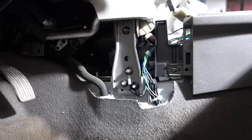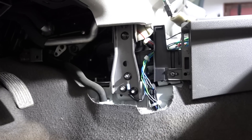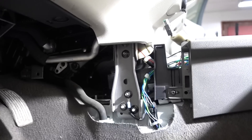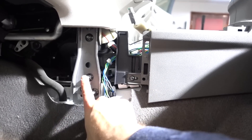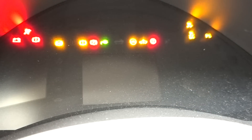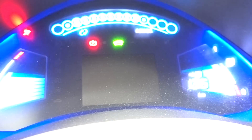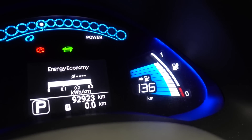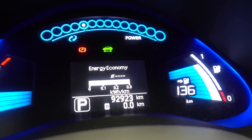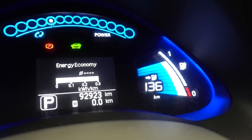That's basically all there is to mounting a CAN bridge onto the older ZE0 model. Most of the splice happens at that one location, then you just ground and pull power, and the bridge is installed. Moment of truth: the 12V battery and service disconnect plug have been reconnected. The installed battery is reading 12 out of 12 bars and no fault codes are active.